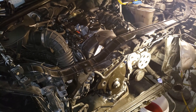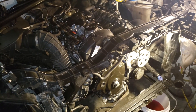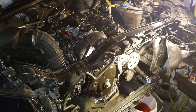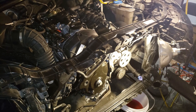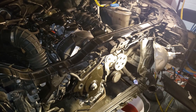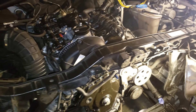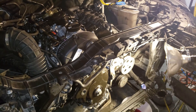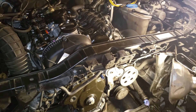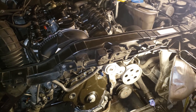What I've been working on is a 2011 Audi Q5 with the 2-liter turbo. It had the oil consumption issue outside of the warranty range at 84,000 miles. I just completed a full rebuild — pistons, rings, bearings, and a complete refresh of the head, including carbon cleaning, new spark plugs, gas O-rings, and every seal and bolt you can replace and clean.